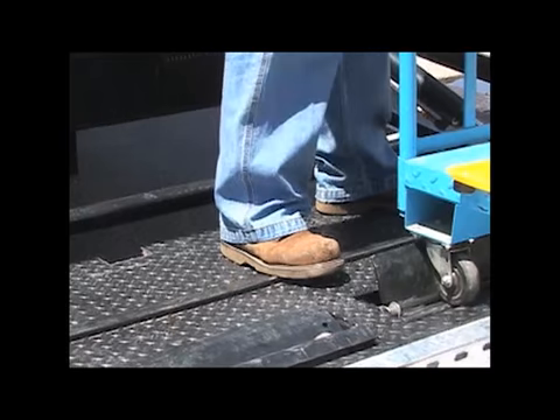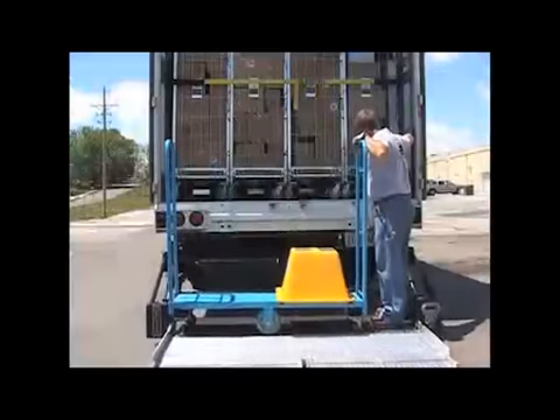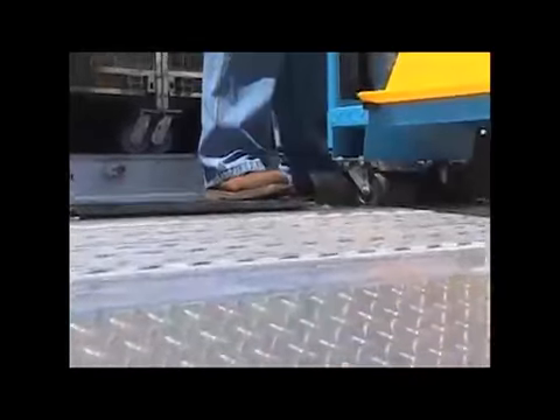As the platform gets worn or covered in ice, snow, or mud, it can create a slippery surface. Do not attempt to move while the platform is in motion — this could lead to serious personal injury. Raise the platform using the inside control switch while holding on to the U-boats, restricting them from movement. At all times, be sure that the liftgate platform is flush to the trailer floor before entering the trailer.